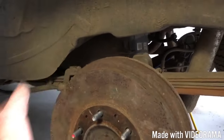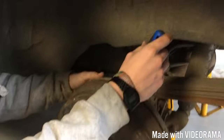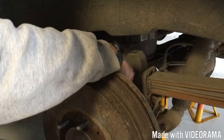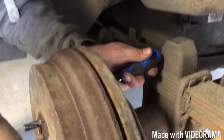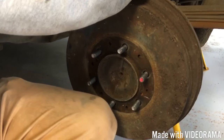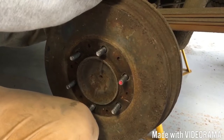Just show that it rotates freely - right. So let's notch it up a little bit - you go in the back there and just give it a twizzle a couple of turns. It's a tricky bit - it's not like working on a Mini, you've got a fair chunk of room behind there. You can find where it is in there and obviously you could adjust the brakes without taking the drum off, but you might as well take them off and dust them - you can do a proper clean and check for leaks.